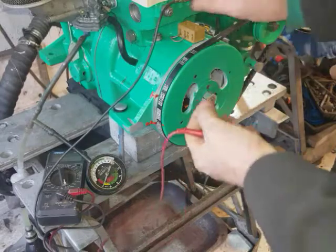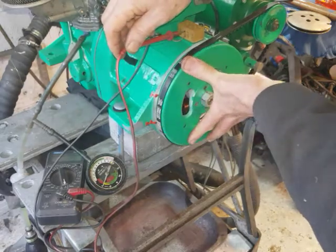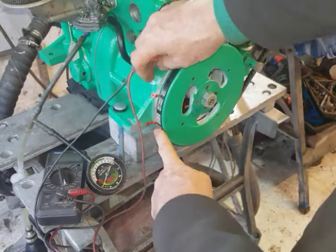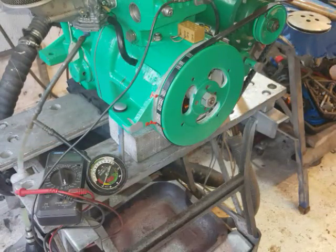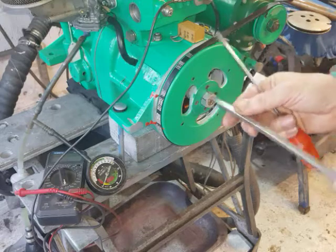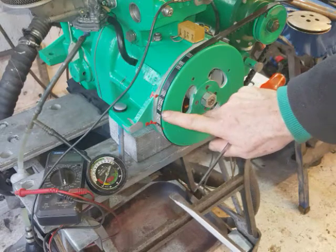I've earthed one side of the meter and connected the other side to where the black wire goes — the ignition point connection. That makes a constant noise, but if I jiggle the flywheel you'll hear an interruption. If you find the exact point where the sound interrupts, that is where the points are opening. You'll see it's exactly lined up correctly on this engine. If it isn't, you need two screwdrivers: a small one to loosen the three peripheral screws holding the back plate, and a bigger one to lever between the coil and one of the screws — I like the top left.